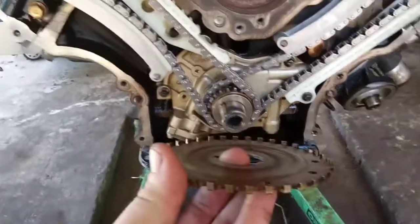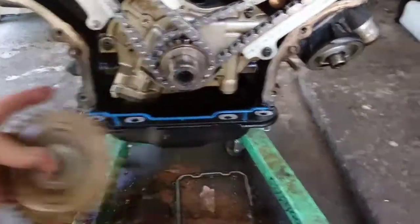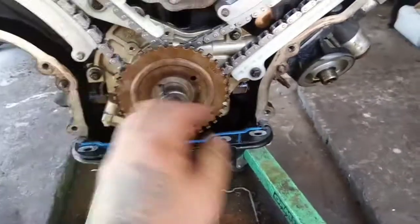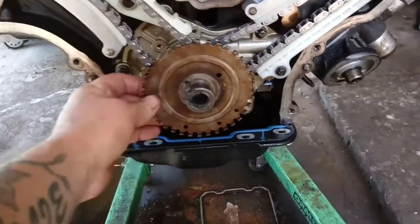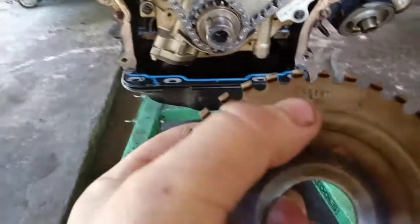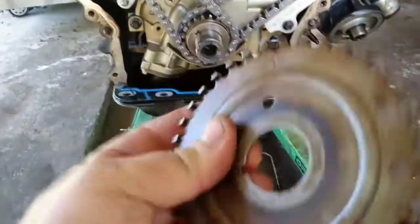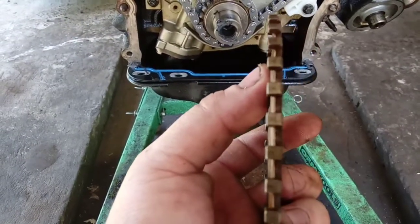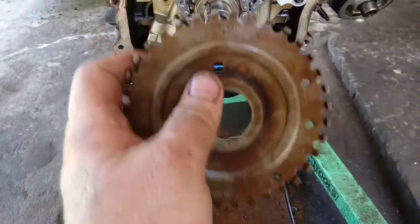This is a tone ring — this is what I call it. It reads your crank sensor, and the crank sensor comes in through the casing. A lot of people take these tone rings off and don't realize there's a front and a back. If they're really dirty, you probably won't be able to see it says 'front.' However, you don't have to clean it — all you need to know is those little teeth face the front, and the smooth side goes towards the back.